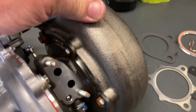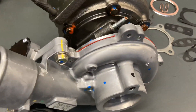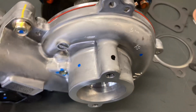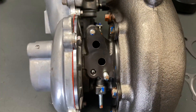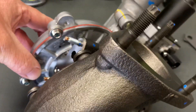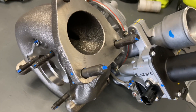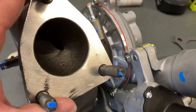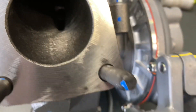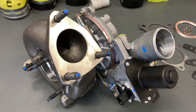Whether you go for a new one is up to you. Whether you go for cheap aftermarket stuff - poor man pays twice, do it more than once. You can go for a rebuild - Ben's pretty good at doing turbos - but I just like the new stuff. We know what we're going to get out of it. It's brand new, quality control. Look after it with your oil changes, switch it off and let it idle a bit if you've come straight off the highway, less EGR, clean injectors. I don't think you'd have too many problems - you'd be pretty unlucky if it happened a second time if you got a turbo from me.